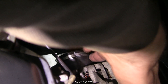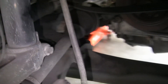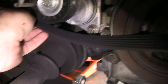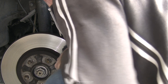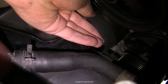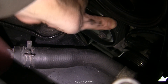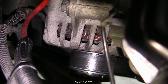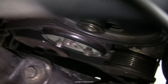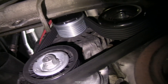The last thing to do on the alternator is to put the belt back on the pulley and route it correctly everywhere else. Again, I have a specific video just on the belt so no elaborate detail here. Essentially I hold the tensioner in with a bar jammed against the steering knuckle, and then put the belt on the water pump pulley last because it's flat so it just slides on easily. Then I release the tensioner and go over all the ribbed pulleys to check that the belt is correctly located in all of the right V's, and obviously that it's actually correctly routed.